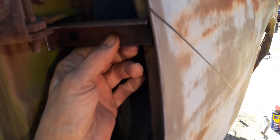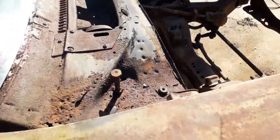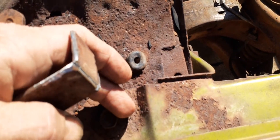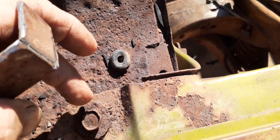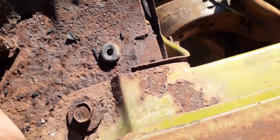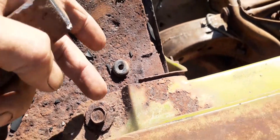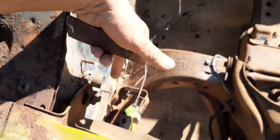With the bottom two bolts, after I fix the bottom of the fender and put a patch panel in it — I already made some homemade ones — this will bolt to the bottom bolt in the hinge and weld up to the bottom of the fender. When this is cut and separated it'll have channel behind it, and this one will be the same way up top with dow pins to help guide them. Up here where the fender actually bolts, it's got a 1/8-inch shim. I'll probably weld that shim into the bottom of the fender, and I'll put a little hairpin hood pin right through here as the locking mechanism, and I'll slot this bottom bolt out.